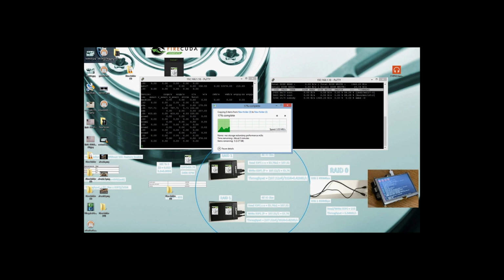We can conclude that all the additional tests will be the same, because as we figured out, the Maiwo enclosure will take only one hard drive for throughput and performance when we configure the RAID 1 feature on the enclosure. Very important to know if you wish to buy those enclosures and implement some configuration.